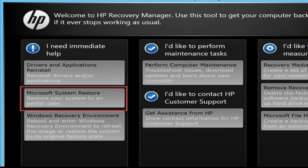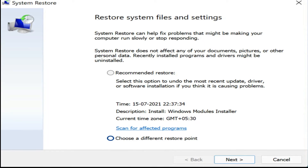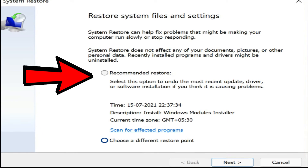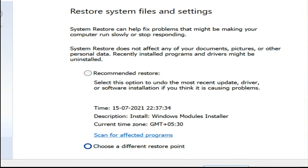Inside the HP Recovery Manager, you'll have the option to run system restore. This should almost always work when accessed this way. From this menu, just simply click System Restore and turn it loose. You can either use the recommended restore point or choose an even older restore point, but you should probably use the most recent one.